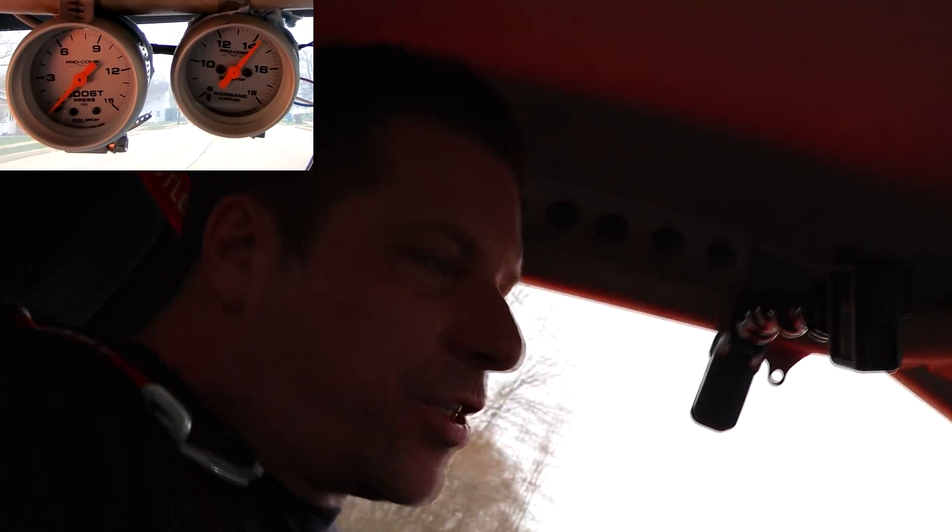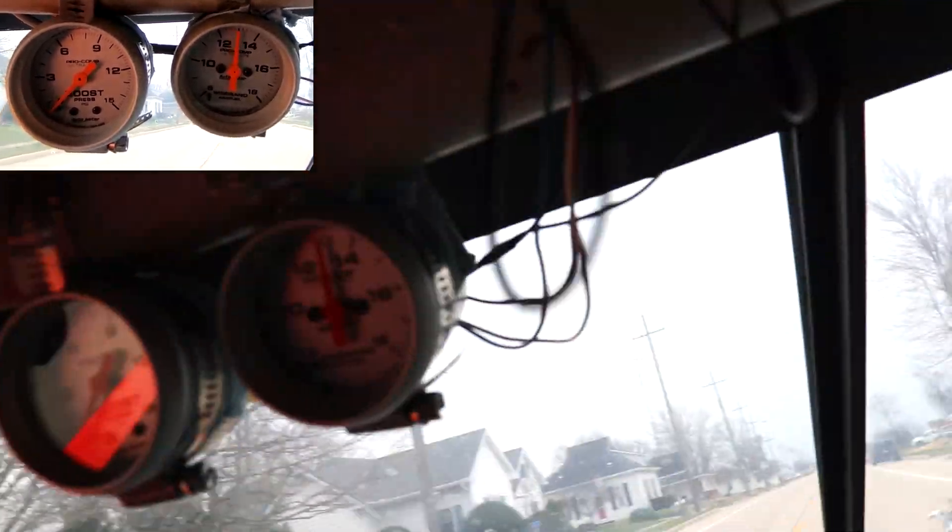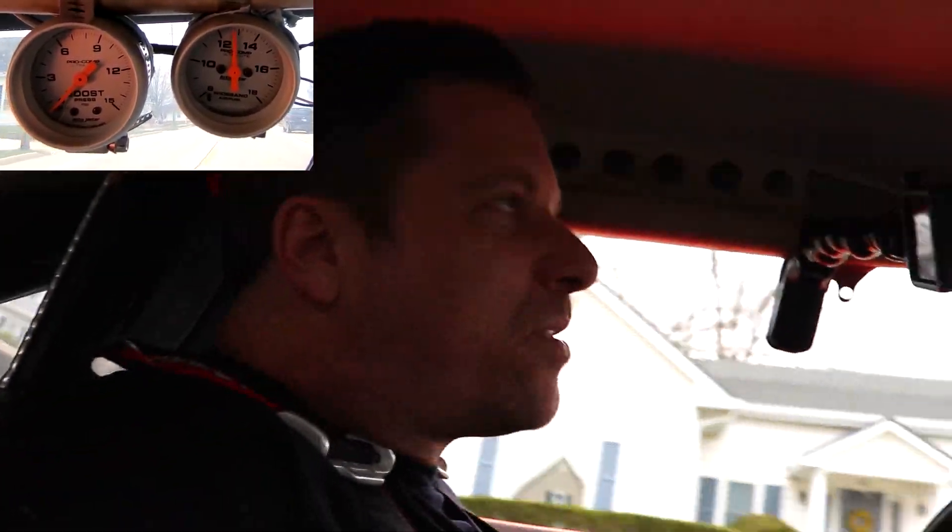When I roll into it, it goes like 14.6 pretty much. That light throttle lean spot is gone. Cruising at 2,000 RPM it hovers right above 12–13. When I lightly, gently roll into it, it goes up to like 15, but as soon as I come off it comes back to 13. Barely on the throttle at just over 2,000 RPM it goes up to 14 then comes back down to 13, 12. A lot of that problem's gone from before where it didn't have enough fuel.